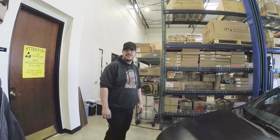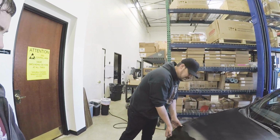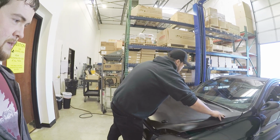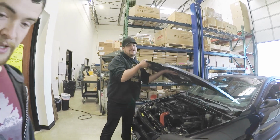All right. So we're going to start today with the engine in this thing, because obviously you can tell it doesn't have the usual motor. What motor's in this usually? It's a 2AZ-FE, it's a 4-cylinder. It's front wheel drive configuration usually, yeah. Okay, so it's typically 2.4 liter dual overhead cam VVT-i? Yeah, basically. But not dual, it's just single VVT-i.